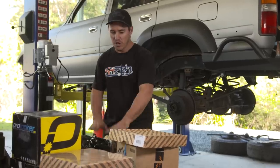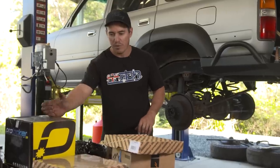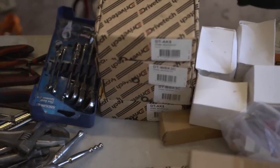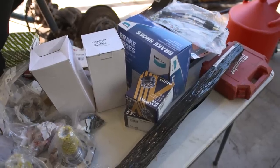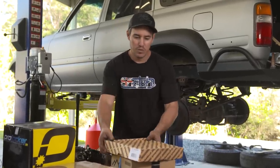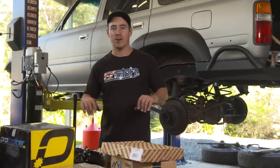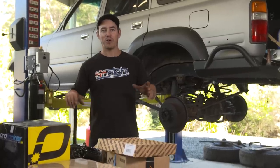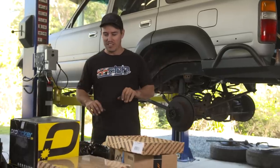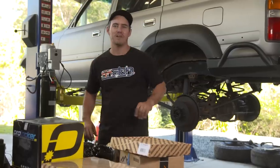You can see there's a stack of fresh parts in front of me. These two diff centers are coming out - they're going straight to Pinnacle to get rebuilt. It's a little bit out of my league to be honest. We've got a couple of TJM Pro Lockers plus a full diff rebuild kit from Drivetek - crown wheel, pinion, all the bearings, everything you need. We're also going to take the transfer case and get that rebuilt. We've got Drivetek parts for that plus some reduction gears - 20% reduction in the old transfer case. That's going to make Sooty an absolute crawly boy off-road. Never had low range gears before in my 80 Series so it's really going to step it up. Being twin locked as well, it should be an absolute animal.